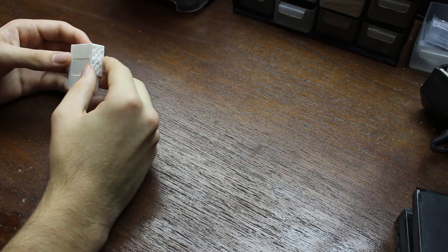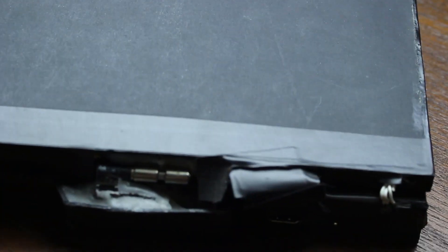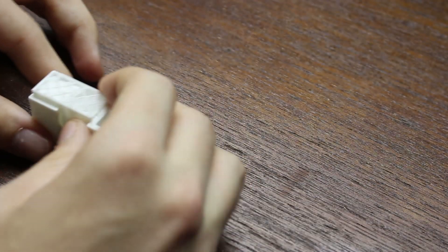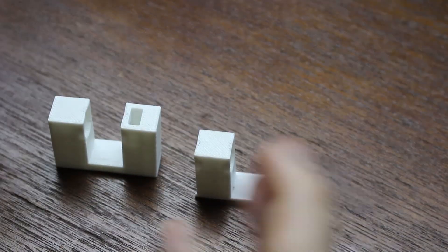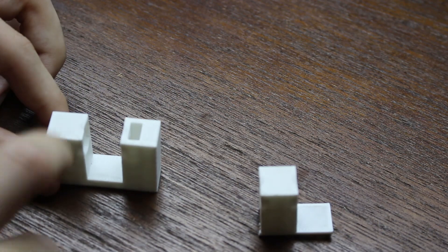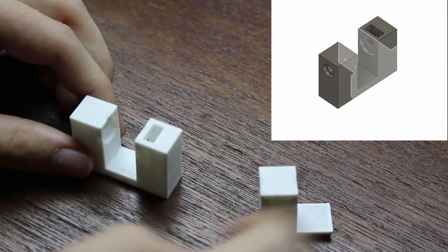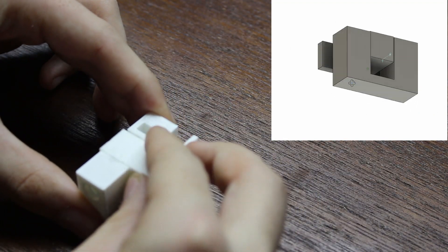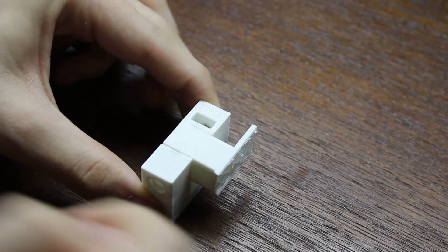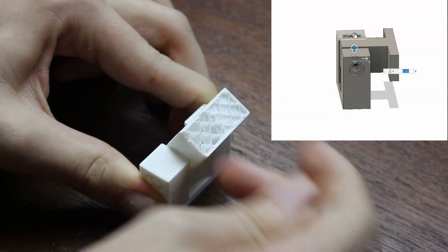Now let's take a look at designing the hinge. In the last laptop video we used a metal hinge that came out of an old laptop. Ideally we don't want to have to take apart a laptop to make a shittier laptop, so in this version we're going to use a 3D printer to create a hinge. The basic concept: we have a T piece and a U piece, both with a screw hole all the way through them, and the U piece has a spot for a nut. You take the T piece and slot it into the U piece, put a screw through the holes, and it screws into the nut to tighten the U piece around the T piece for friction — giving us a very basic hinge.